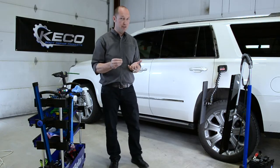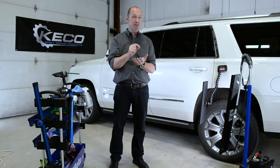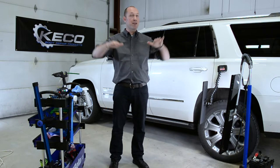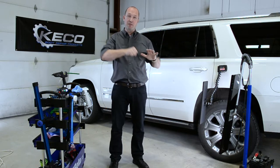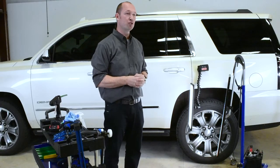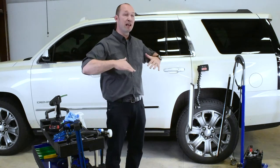One general rule is the tab always needs to be smaller than the damage. If it's small damage or bigger damage, stay away from the high spots and glue your tab in the low spot to correct the metal. There is one simple reason: if you want the metal to move back to its original shape, the metal needs to be able to move.